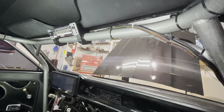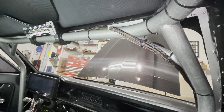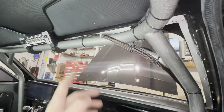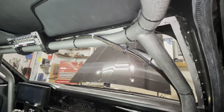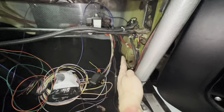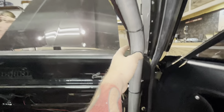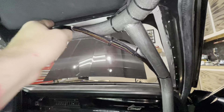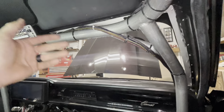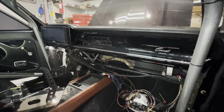Here's what you got with it all put back up — wires just zip-tied. Originally I had my wires tucked on the outside of the roll bar so you didn't see it from inside the car, but servicing that's actually a pain because then they're behind the bar. I'd rather have them go on the back of the bar right here because they go over to a fuse block and then come up here and wrap over the inside. That way if this thing needs to come out — two bolts, cut some zip ties, flip it in — you can easily work on it.